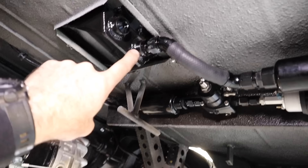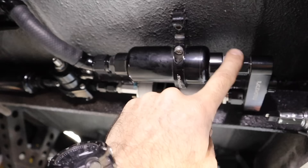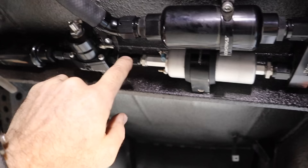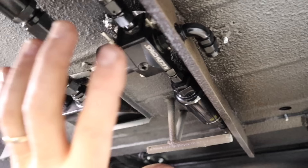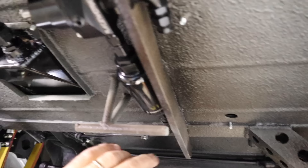Exiting the fuel tank, I've got to plug one of the holes. I have the dash-10 line going into the pre-filter, then it swings around going into the fuel pump, fuel pressure regulator, post-filter, and then through the fuel lines up to the front. The return from the fuel pressure regulator comes up this way. This is a deadhead system — so the fuel pressure is regulated back here and it keeps the pressure in the line going up to the front. This is the return which has to come through and go up into the tank.